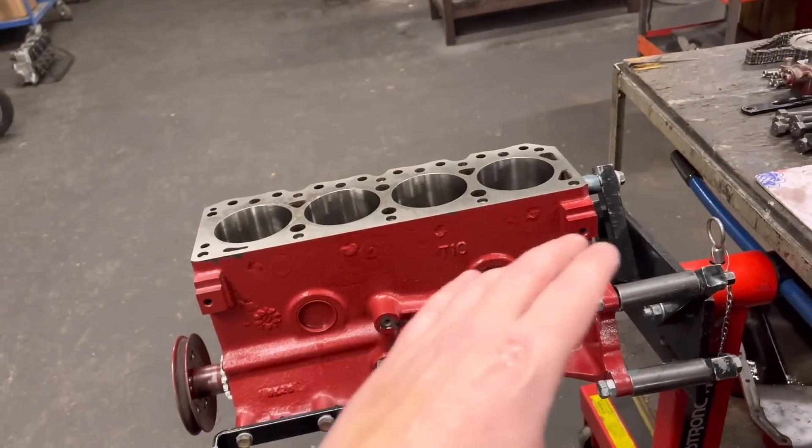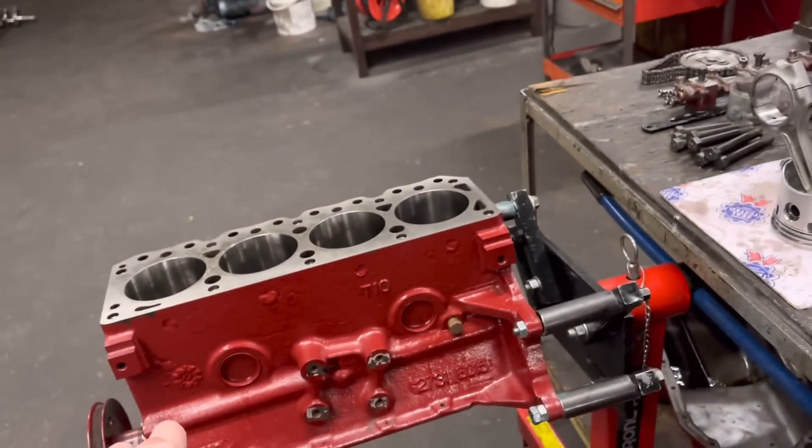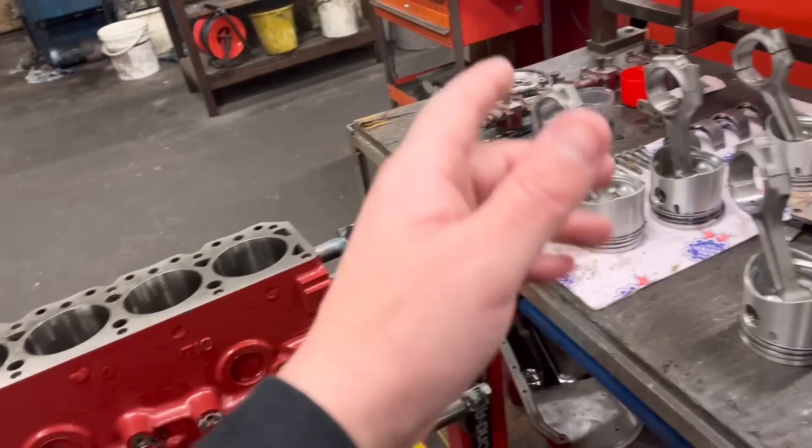So they've either slung it together - which I can't imagine they have because obviously you've got a full set of gaskets, it's all been built right, it was all torqued down to spec. They spent the time boring it and doing everything perfect. And how much the line boring is with those caps is going to be big money. And then they've put the rods in the wrong holes and put two of the caps on the wrong rods. So this thing, as soon as it fired up, would have scrapped the rod, scrapped the crank, and more than likely damaged the bores and pistons and made a hell of a mess. So that is one reason why we never take it for granted.